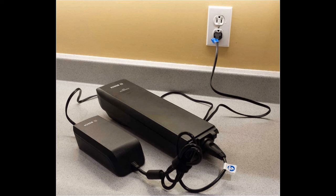You might be wondering how long it takes to charge an e-bike battery. The majority of e-bikes come with either a 2-amp or 3-amp charger that will charge the battery within 4 to 8 hours, depending on the size of the battery. There is no such thing as fast charging for e-bikes, which is something to keep in mind if you're riding long distances in a day.